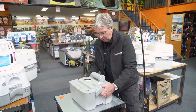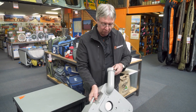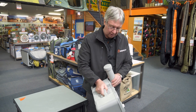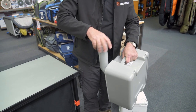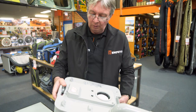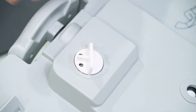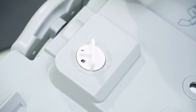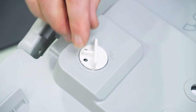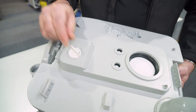This bottom tank is what you take to the disposal point. If you're in a campground, make sure you ask where to pour the toilet out — if it's on a general toilet, they may not like it as it makes a bit of a mess. So we swivel that around, undo the cap, and there's a little valve here that you spin around. That opens the little ports and allows air into the tank, so when you empty it out you don't get any slopping noises or dreadful messes. When you're finished, you close that back up again using the arrow indicator.